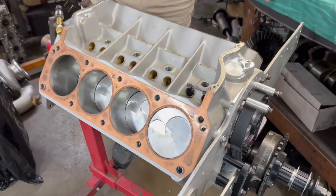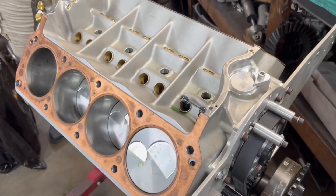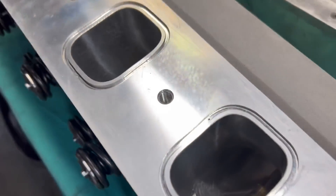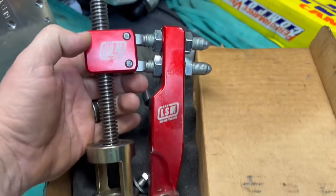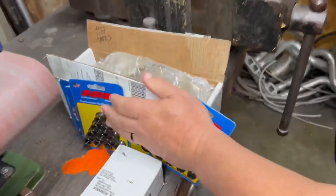Check it out guys — comment, like, and subscribe. Go to turbojohnracing.com; we got hats, hoodies, and long-sleeve t-shirts available. So y'all haven't seen this motor in a while — it hasn't changed, just been hanging out waiting to make some power. These heads are from CID, ported by Race Flow Development — they are monsters, very big. We're going to take these springs off; Shannon Young from Bloodbath Racing has the tool we were missing last time. We'll use it to take the valve springs off so we can check the piston-to-valve clearance.